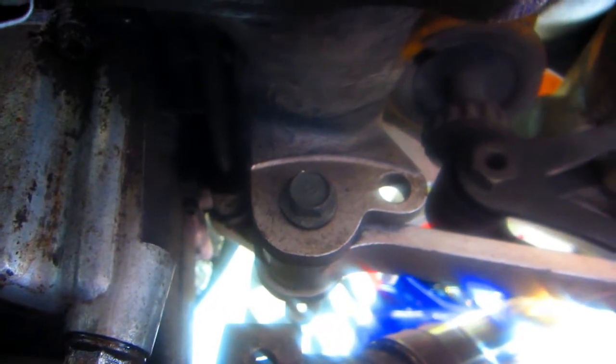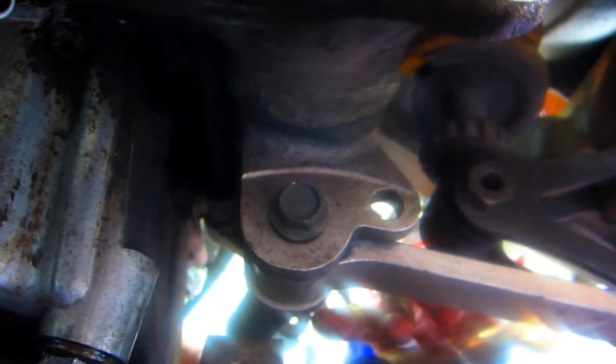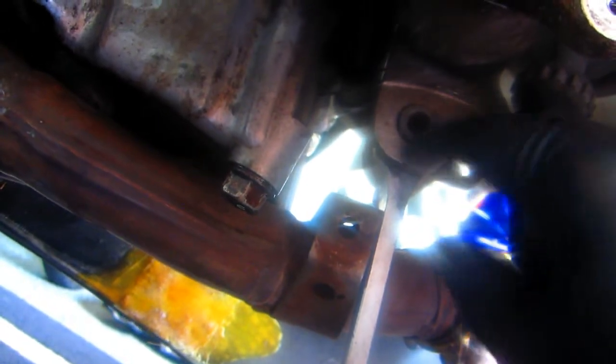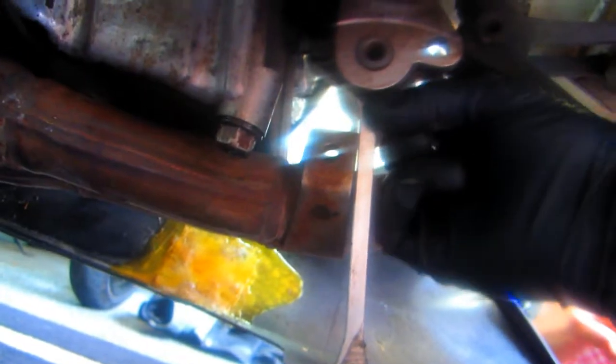Yeah. We'll try it both ways. There's a bracket right in the front. Look. No matter, back wheel is loose. This piece can come off. But that's a bushing in there, so we got to tap that bushing out from Luciano's side before we can pull that bushing. It's got to be tapped out from your side.